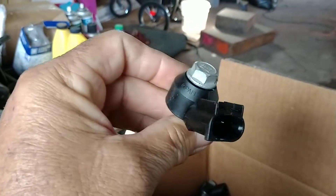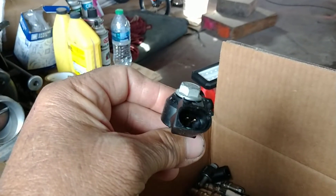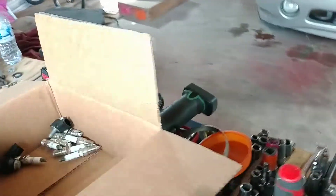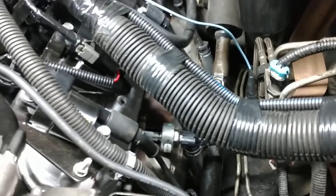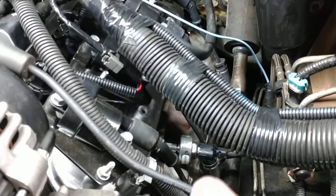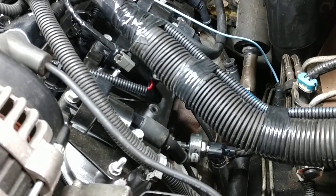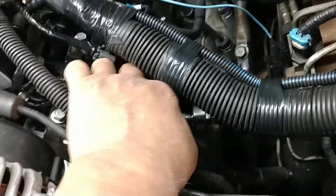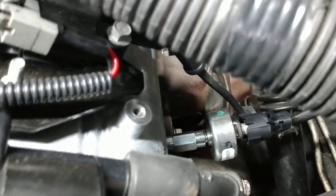That's what comes in on that crate motor — Gen 4, 2008 motor. But you need to run the stock ones, because the computer is pretty dumb, they say. I put an adapter on this side because this truck has an oil cooler, and where I re-tapped the line on the bottom of the block, I couldn't get to it because the oil cooler lines are in the way. So I put a little adapter on this to extend it out right there in between the heads on the driver's side. It seems like it's going to work there.